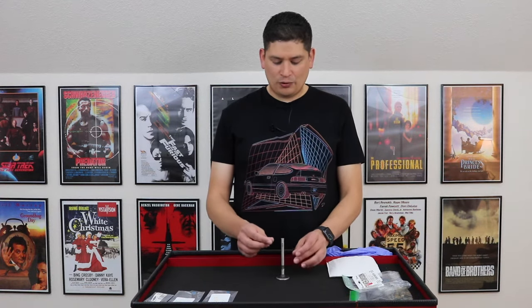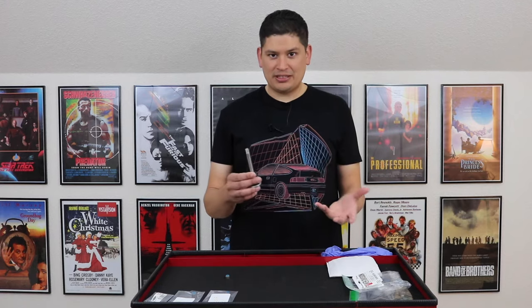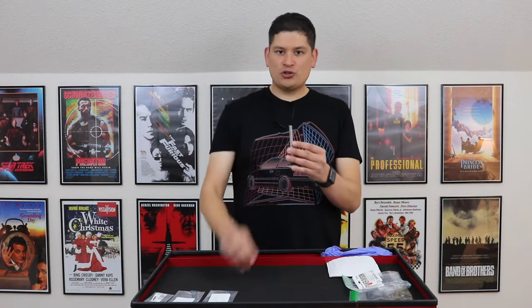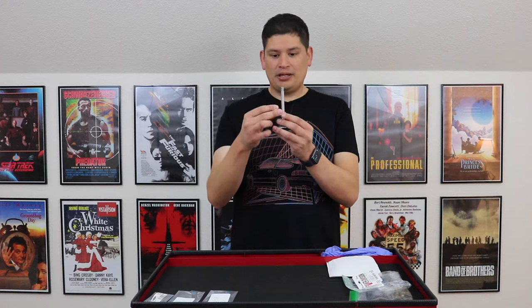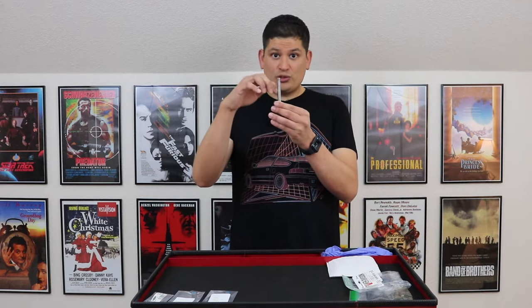Now let's look at how hypothetically it would work. Your head is right here and this is the part that sticks out. The spring goes over it, and the keepers, and the top. Where the valve stem goes through on the guide — usually a little brass thing where it slides up and down — there's a little bit of a tolerance opening. If the valve stem seal wasn't there, oil would just seep down. So the valve stem seal slides over this, goes all the way down, and sits at the bottom. When the head is being lubricated and oil gets swashed in there, it can't go through down the valve guide and into the cylinder.